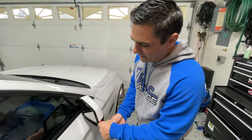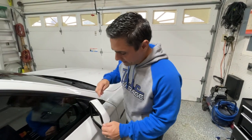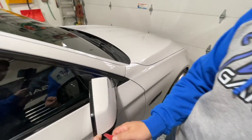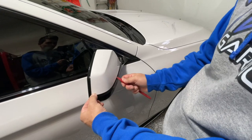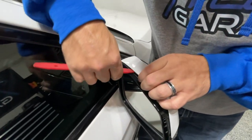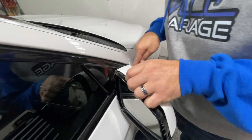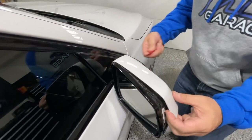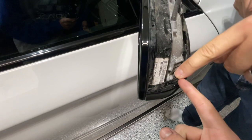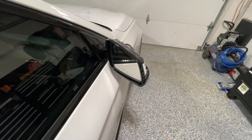I've got a little pry tool here. We've taken these off before because I attempted wrapping them. The top part isn't too hard to pop off — it's the bottom one that I think we're going to have some difficulties with. I start here in this corner and then work towards the inside of the mirror. There's another clip over here, and once you get most of it off there's a clip right there — just push it in. Looks like it's screwed in, so we have to take the mirror off.